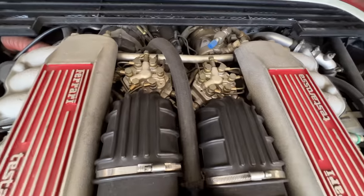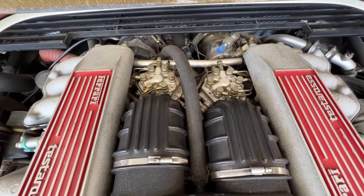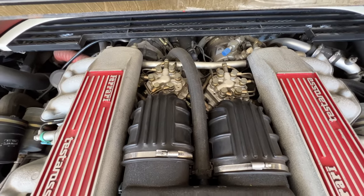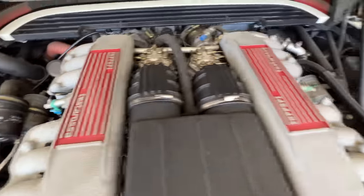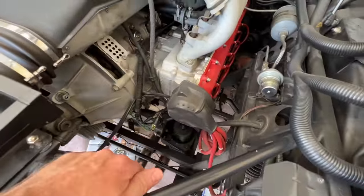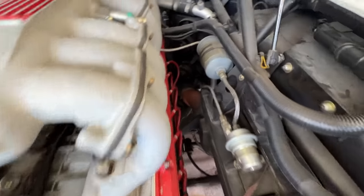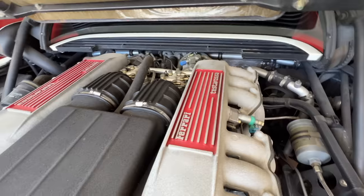Basically this is two DeLoreans — it's just Bosch K-Jetronic mechanical fuel injection, but two of them. The same one that's on the DeLorean. These are the same exact cold start valves, probably the same warm-up regulators, same fuel accumulator. That Bosch system was used on a lot of cars.